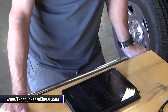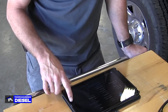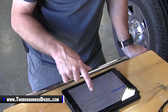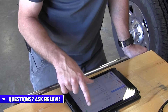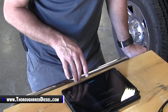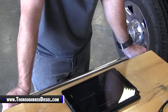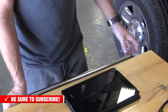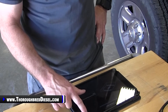We're going to check for updates — you have downloaded the latest firmware version. Then we go back to settings, pick up EZ-Link again, go back to Auto Agent, and hit install now for the firmware. The key is on, we've confirmed that, and now it's going to transfer some files to the Auto Agent. Do not unplug the Auto Agent or turn the key off during this process. With the magic of modern technology, we're going to skip ahead as you won't need to see all of this.